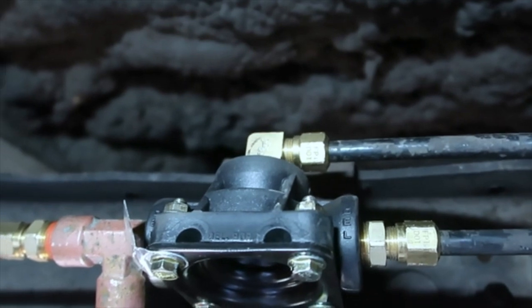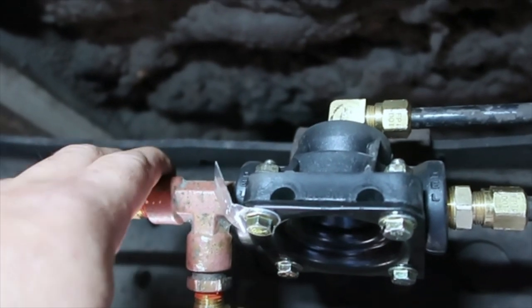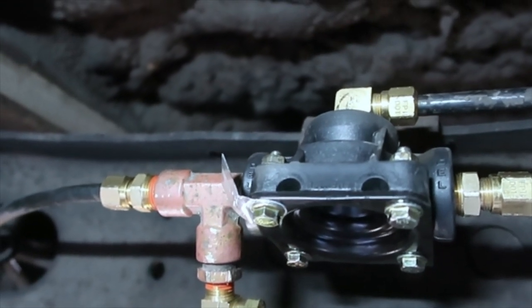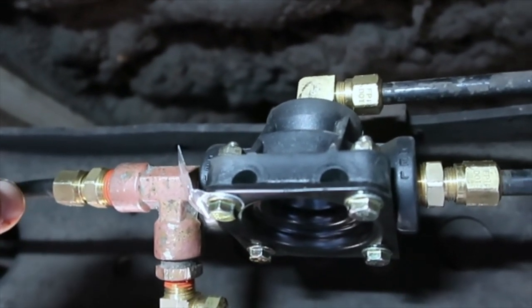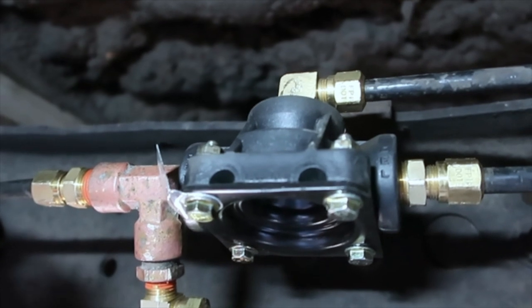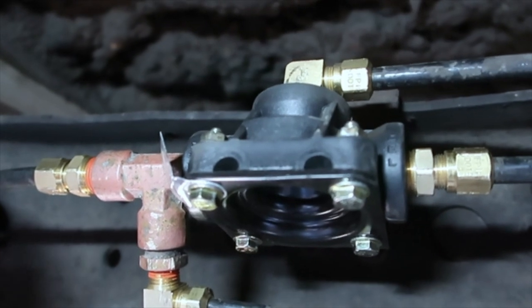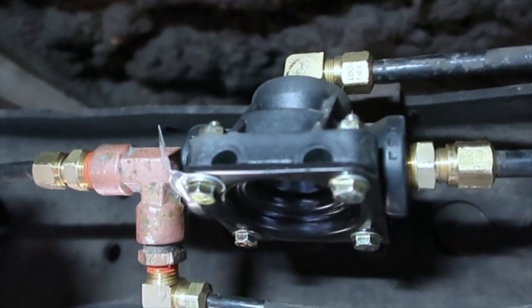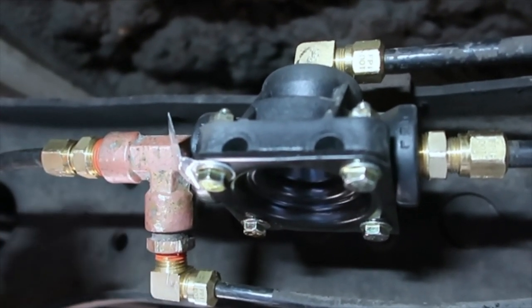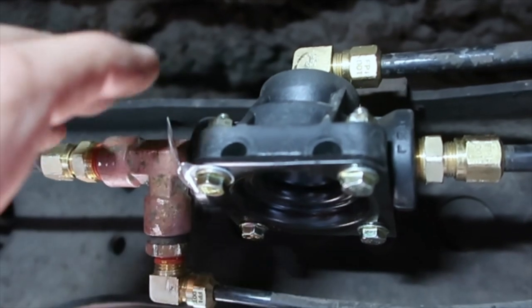But no air leaking. And should do it, and I don't hear any air from anywhere else. It's kind of like one of them things with airline leaks, just like with hydraulic leaks. This truck's 14 years old and not a whole lot of things have been done to it, so over time, once you start repairing parts that are bad in the system, you start getting fails in other sections, so you start tracing things from one place to another.